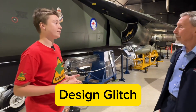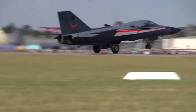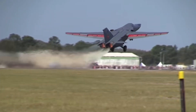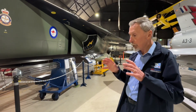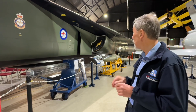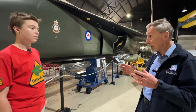Based on my internet research, you guys had an issue with these wings snapping off. We didn't in our Air Force. After the aircraft was first introduced in the US Air Force, I think they lost two or three aircraft where one of the wings separated. The issue was the steel used for the main structure to hold the wings onto the aircraft was a relatively new steel and its characteristics weren't particularly well understood.